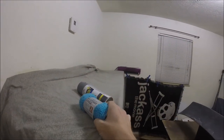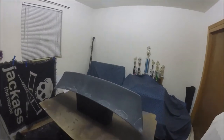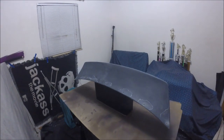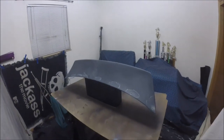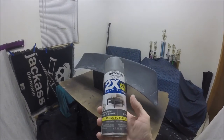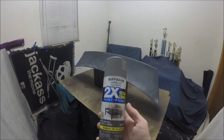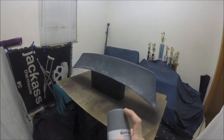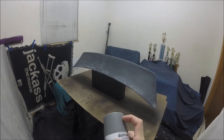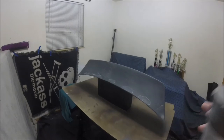Bam! Alrighty, bros, room is set up, so now I'm going to do the usual, get some 90% alcohol, microfiber towels, and get this thing nice and clean, man. Alright, man. This thing's nice and cleaned up, so now we go ahead and start spraying the primer. You guys know the same stuff I've been using for a while now. It's actually sandable. Stuff's actually pretty amazing. And it's a lighter color gray, too, which makes it much easier to see the places that you got and the places you haven't got when you go over top of it with paint.